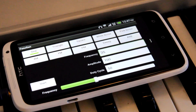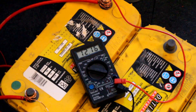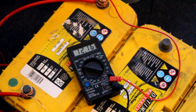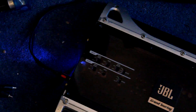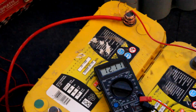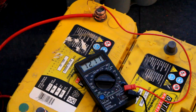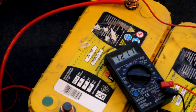I've got a 35 Hz test tone on the mobile phone ready to go. The amplifier is set to a certain level, X-Blood all wired up. At the moment on idle, the batteries are sitting at about 12.16 to 12.17 — it keeps jumping up a bit, so the battery is actually gaining more voltage as I leave it. The amplifier is sitting idle. It's only running one of the front channels bridged at a 4 ohm load, so it's probably not giving the amplifier too much stress, but we can see how the battery copes. It should still sit at about 11.8 or 11.9 on the drop.